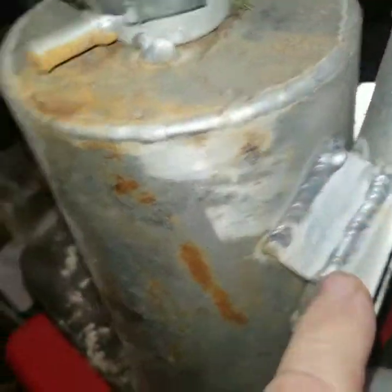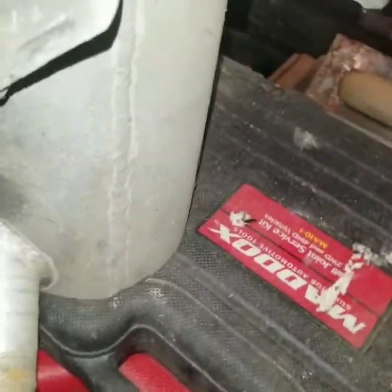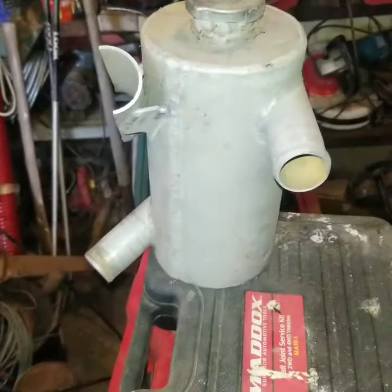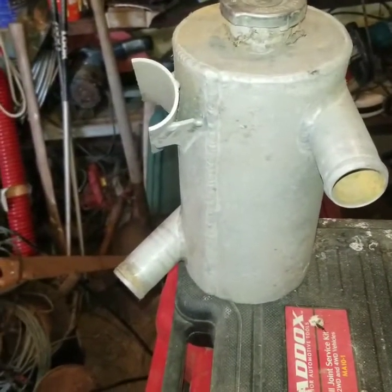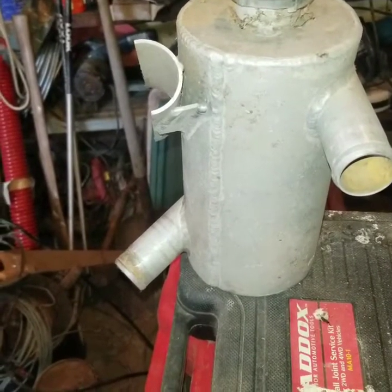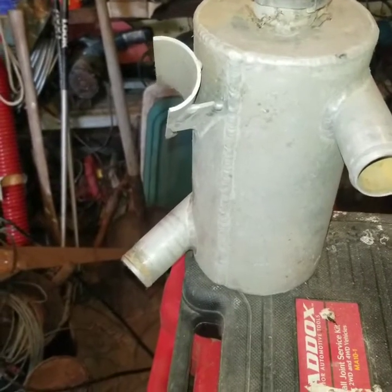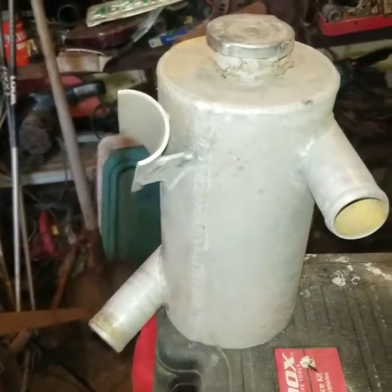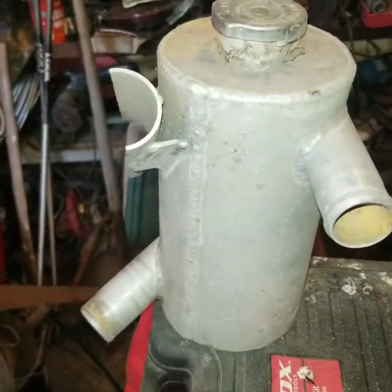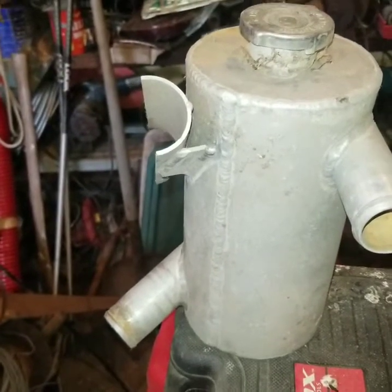What I saw online was a picture of a Lotus — a lot of European cars had it. This device is mainly used in a performance car; your daily driver wouldn't need it. Basically it's used in a car where the amount of water you carry is minimized and your radiator size and everything is minimized for performance, so there would be times under hard acceleration and high performance where you may get vapor pockets in your engine.